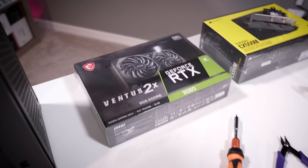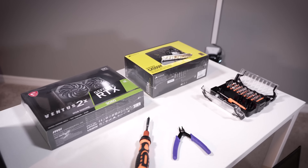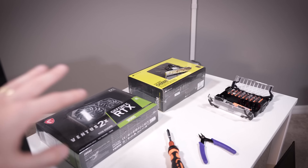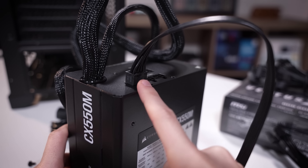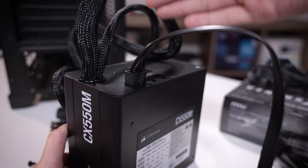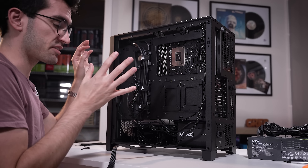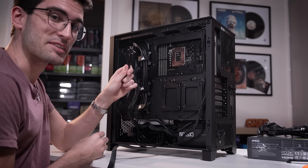Looking pretty good so far. We only have two and a half other components to install: the graphics card, the power supply, and the WiFi card, which also comes in the box with this particular Corsair build kit. One of the side effects of a cheaper budget build is you don't have crazy RGB to wire up, no AIOs, fans, and pumps to connect. All we need to connect to the semi-modular unit is one single cable for PCI supplemental power — we don't even need Molex or SATA power cables. The 4000D has tons of space behind the motherboard tray, Velcro straps, cable channels, and zip ties.